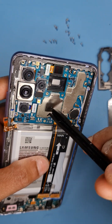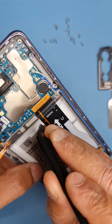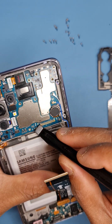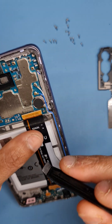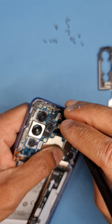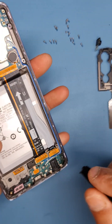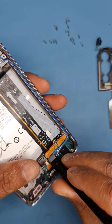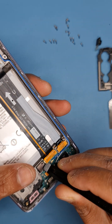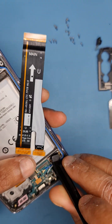There's a small gold marking here — try to pry it off from that point because there are components right next to it. Be careful not to damage them, or the phone will be quite difficult to fix since they're very small components requiring correct tools to replace. Be positive, take your time. That gold marking tells you exactly where to pry from — do not use too much force or you'll damage the capacitors.